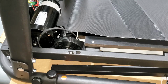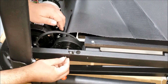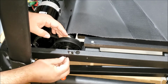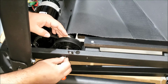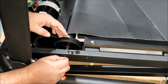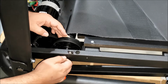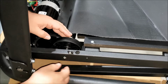At this point, grab the bolt that you pulled from here and just thread it into place. Pull or push the roller towards the screw. Alright, what you're trying to do is play around with it. Alright, find the hole right there. Now don't fully tighten it, just as long as you've got it threaded in, so it's not harder to get on later.